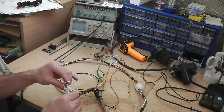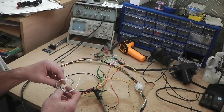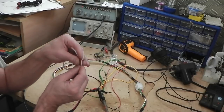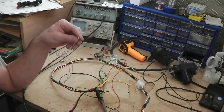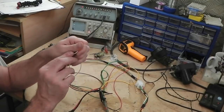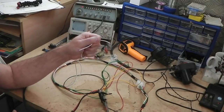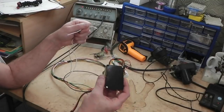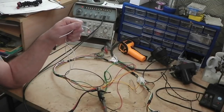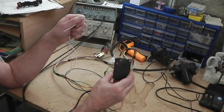This extra pair is actually the 12 volts to the gearbox or the relay. What you do, so that it's on a separate fuse, is that you're not using the fuse off the controller. It's always prudent to have different circuits fused independently. So I could just have had one single 12 volt output wire on this going to the solenoid on the gearbox. But that would mean if the fuse blew for this, the gearbox goes off. It doesn't really matter because this is the only thing that's controlling that solenoid, but it's better to have the gearbox solenoid independently fused, not the fuse off this.